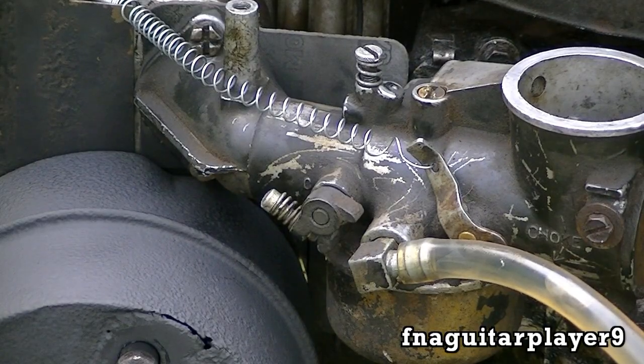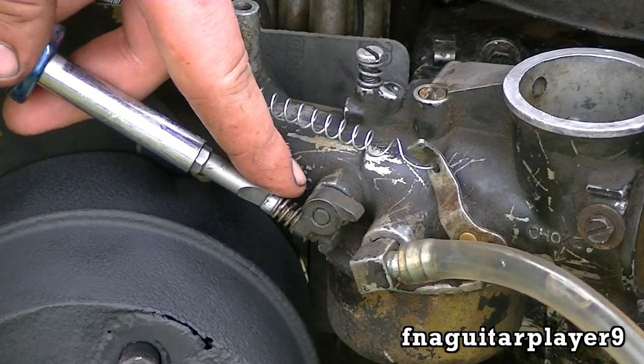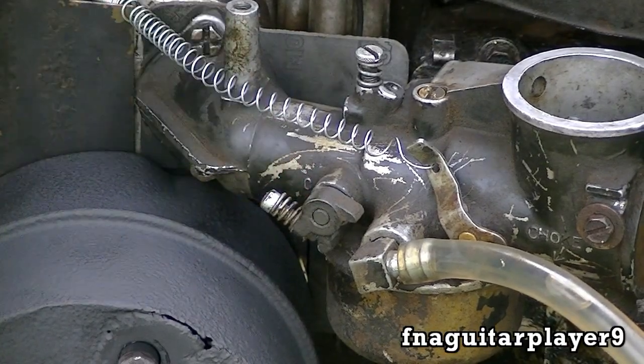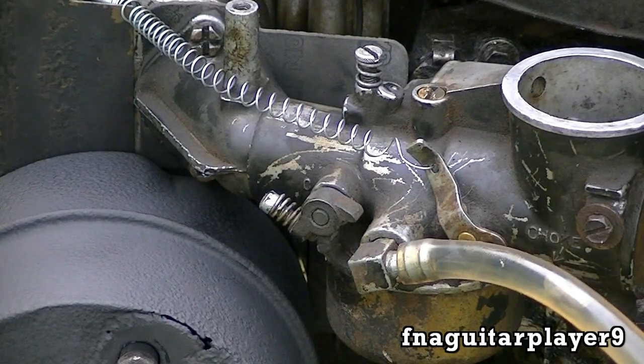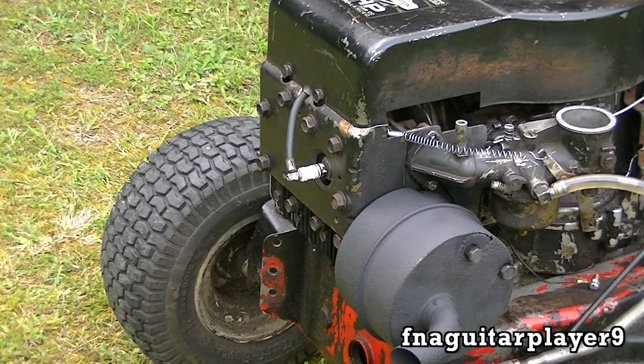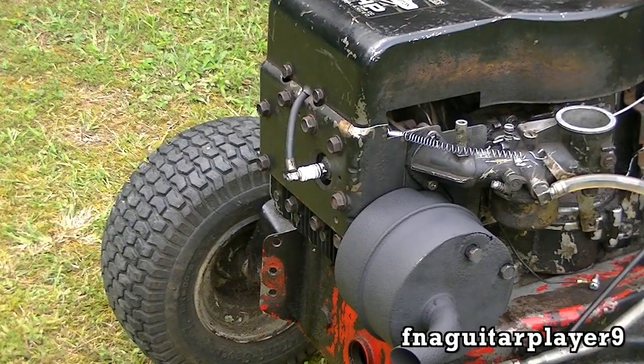As you can see, I bottomed it out and we tried to idle too slow on that side. About right there is where it wanted to idle. Now most small engines idle at about 1800 RPM. In order to get it adjusted right, you have to get a tachometer attached to the spark plug wire and the ground — that way it will give you a readout of what RPM the engine is running at. This is just an approximate guess. If you get it running too slow, the oil won't circulate well in the engine and you can cause bearings to start wearing.